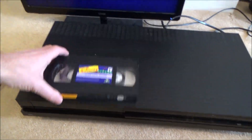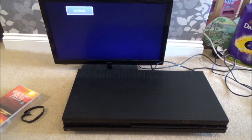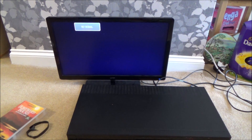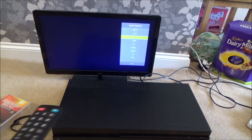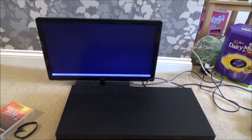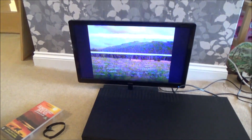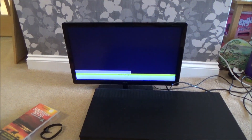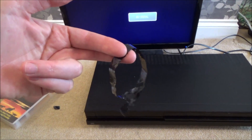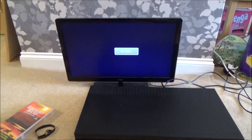What happens with it is when you put the tape in, sometimes it will play for about two seconds and then just stop. Let me make sure I'm on the correct input — I've got it plugged in via SCART. You can see it recognises it, I've got power, but if I press play it comes up and then stops. When I was messing around with it, it chewed the tape up, and if I press play again it only ever plays the same bit over and over again.